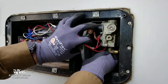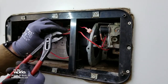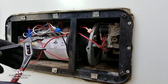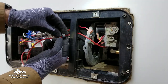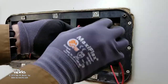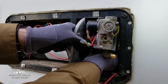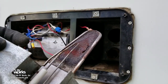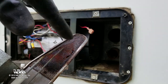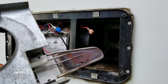I do have a little bit of tightness right here, so let me disconnect. Here's another trick — there are a couple ways to get that off. Using channel locks, I can see the orientation of this little crimpy thing and give it a little squeeze to pull it out. That's one of these compression connectors — you just squeeze it and free it up. Give myself some slack. Pull it all the way out and this little assembly just comes right on out. Make sure it's not caught on the gas line. So here we have the problem — that's what we're going to be replacing.